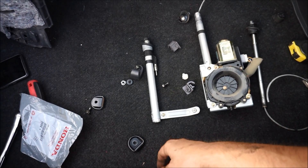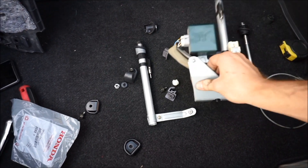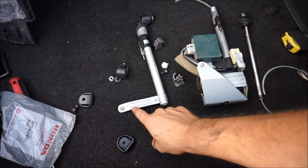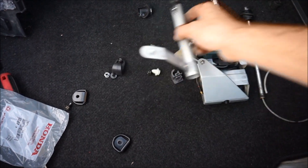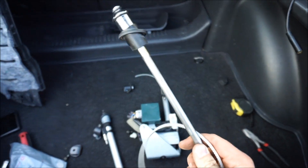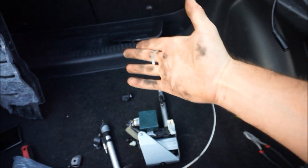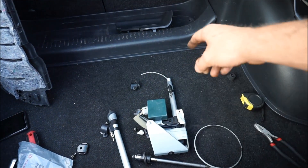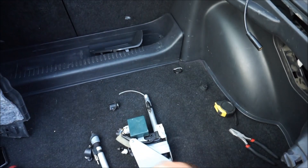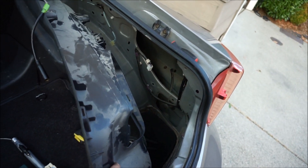So 2000 to 2002 right here, and then this is the 03 with the giant antenna. Look at all this extra weight - I bet this thing weighs like half a pound. Same mounting point right here, which is going to be this guy. Same mounting point, same antenna - this thing has an antenna plug-in. So we have those out. And this is actually the one that came with the car too. I could probably use this grommet or the other grommet - it's probably one and the same. I did cut this long extension wire because I wanted to separate this and pull it out the top of the hole, and pull that one down below, connecting it that way. Now you don't have to do that. So that looks pretty 2000-ish to me.